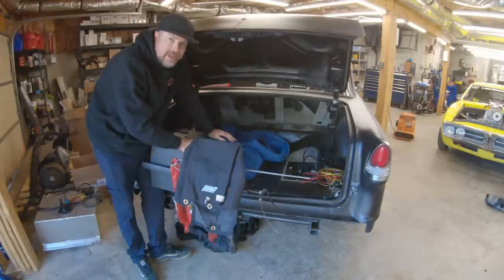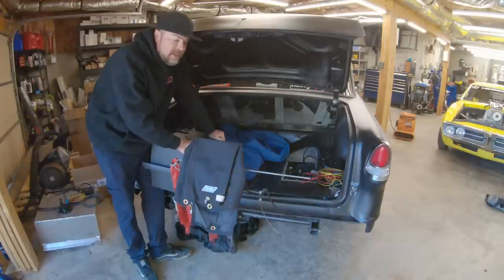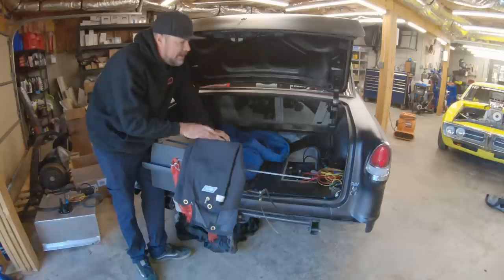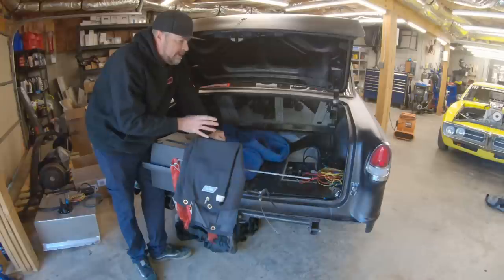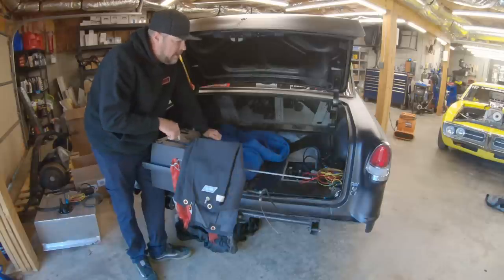The old setup in this car was a 3.25 rear gear, but that was with the other transmission. We used to have a G-Force GF5R 5-speed in this, and it had a 3.25 first gear. This one has, I think, a 2.79 first gear. It's wildly different ratios in this transmission. And it drives good on the street. It drives really good on the highway. We just need to get our final drive ratio and our starting line ratio where the car is happy. And I think this might be a good swap to make. But we'll do this later.